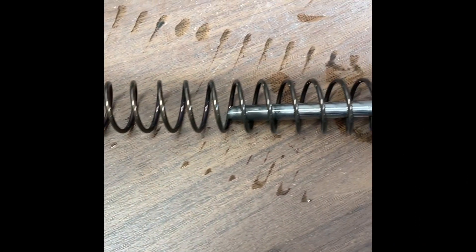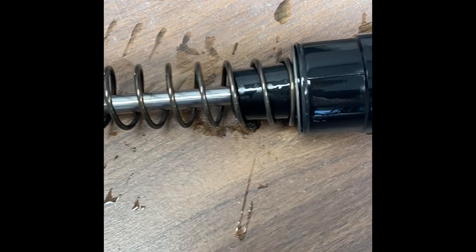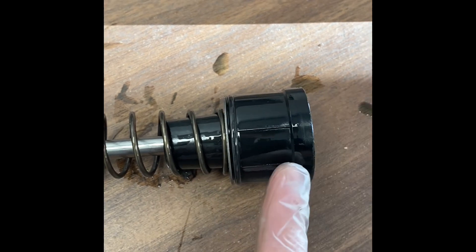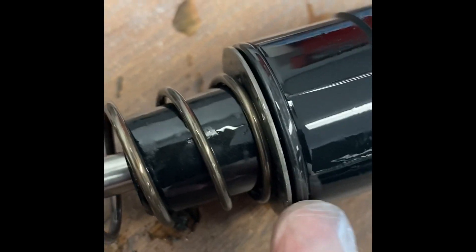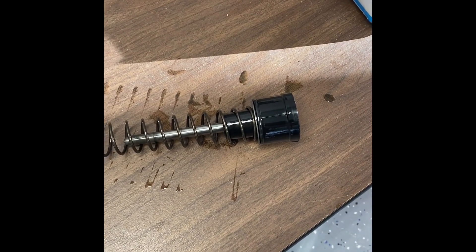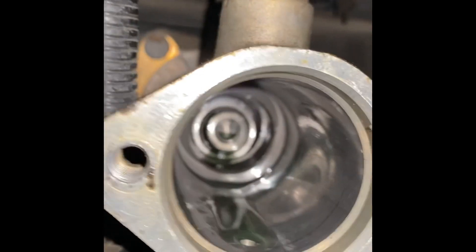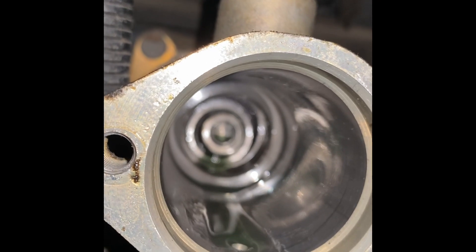This is the assembly of the front body piece — you get four pieces: the spring, the flat washer, then the O-ring — or the front body seal as they call it — and then the front cup. If I'm lucky, this O-ring right here is our culprit. I've got a couple, so I'm going to see what size works and go from there. Just making sure nothing got dislodged in there — it looks pretty good. So I'm going to go ahead and reassemble.